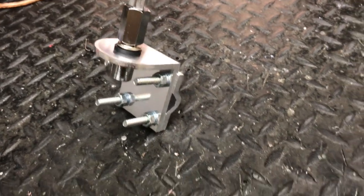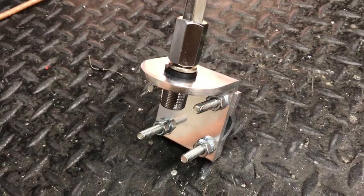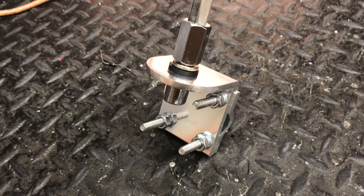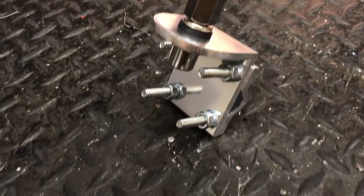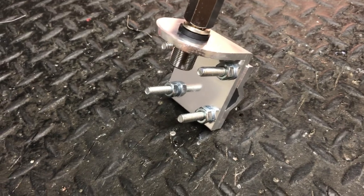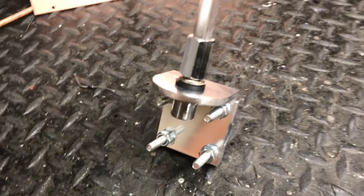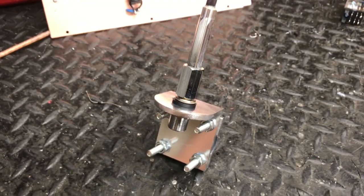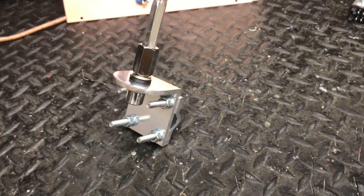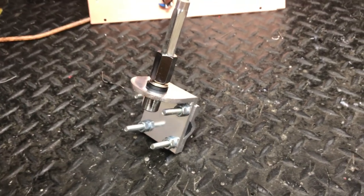For any kind of amplifier, run a hot wire and a ground wire all the way to the battery. If you want to keep a short ground for your amp, run a short ground from the amp to the first bolt at your seat, then run a wire from that bolt all the way to the battery. Hope this video is informative — just trying to help you out and make your equipment last longer and protect your investment. Thanks for watching. Your friend in 10, zero one eight, Beavis — catch you later.